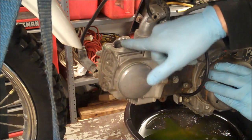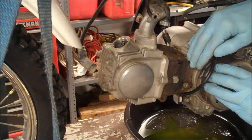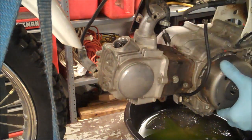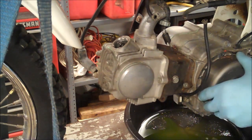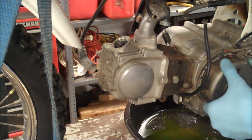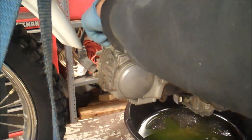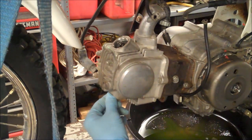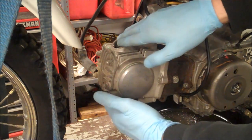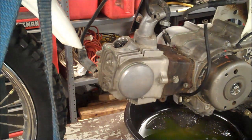So right after the intake valve goes down, the piston is going down drawing in the fuel-air mix, and then as it comes back up that is top dead center. See it's closing — the piston is coming up and now we're at top dead center. When I come over here and wiggle this, it should be loose. Now we know the piston is at top dead center and the rockers are on the base of the cam, so we can begin to check the clearance.